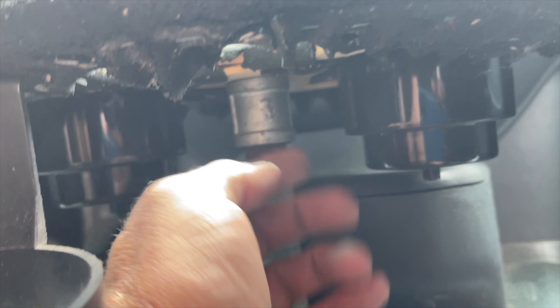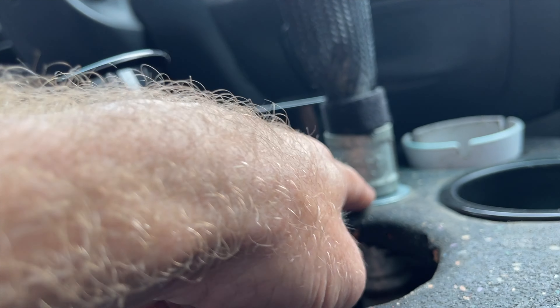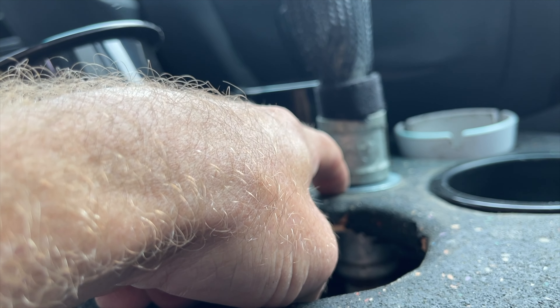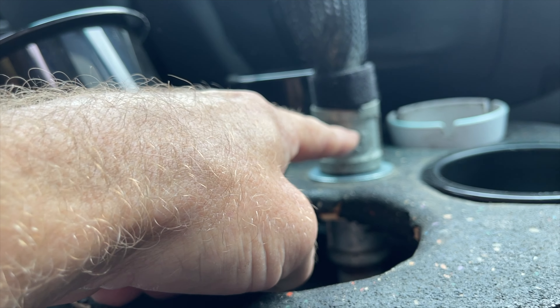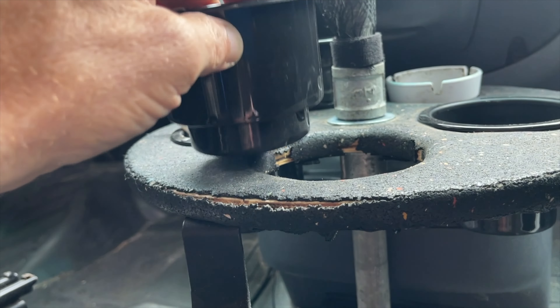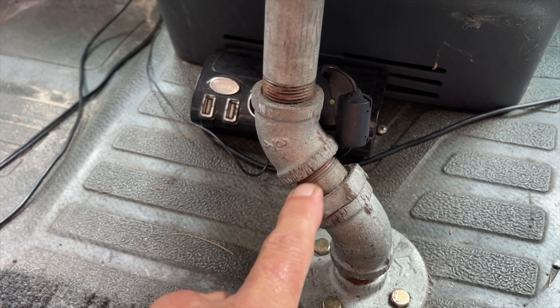There's a pipe fitting on top, then a hole in the center of a round board, and above that another short nipple going through it. A couple of washers space everything up and make it tight, then run a coupling down onto that nipple — that squeezes it really tight so it doesn't wobble or twist. A threaded nipple is just a short pipe with threads on both ends.